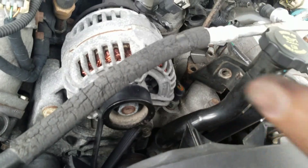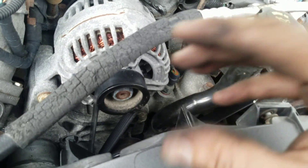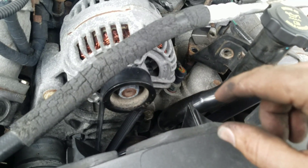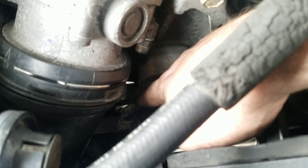As far as putting it back on, just keep note of how it's on there. I'll draw you a little picture after this and kind of give you an idea of what the belt routing looks like. So it's pretty difficult. When I was putting it back in, you're going to have one person standing up here. You're going to feed it in on the tensioner side first, and you're going to get the belt around the tensioner. That's going to be the first thing you're going to do.